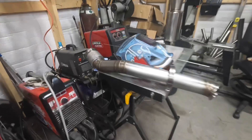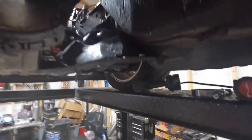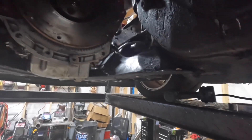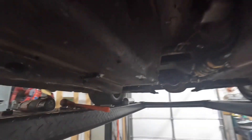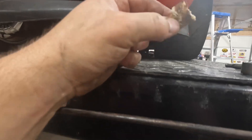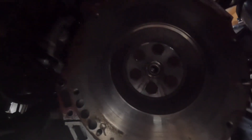I've got one of these sitting in the refrigerator here in the garage and I'm about to go ahead and put it into the crank. One thing I fought super hard when dropping the trans was this bellows wedging itself against the subframe right here and between the trans. I ended up cutting a little slot because typically you just tilt the back down and slide it out, but it was wedged up in there. You guys might find this funny but this is the bread trick — it took a lot longer than when I tried it yesterday at home. Just like that, new bushing's in.